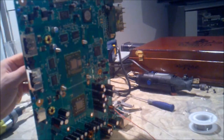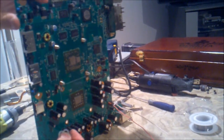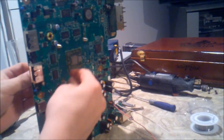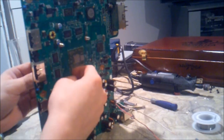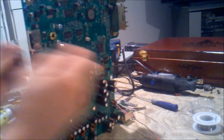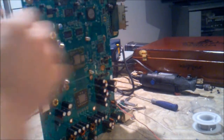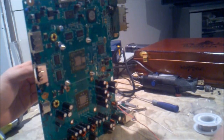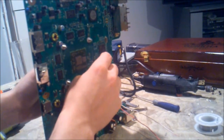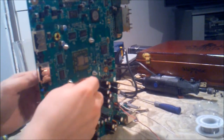Now the next step, after we have the screws in there, is our nylon washers. So we put our nylon washers on. Nylon washer protects the board from the steel washer that we're going to tighten down. That's all that's doing, as well as a space holder, so we don't smash our chips. Alright, now that we have those on there, we're going to do our steel washers next.